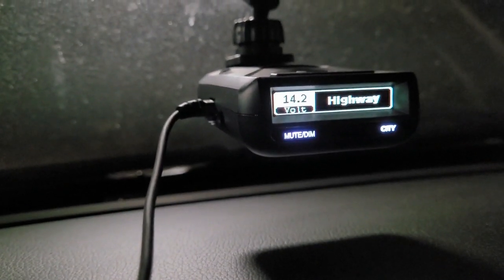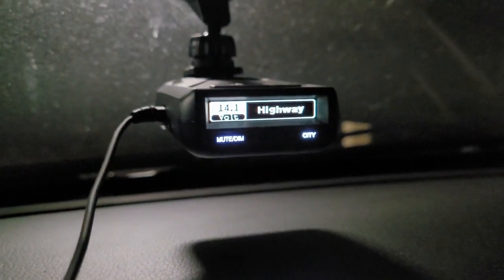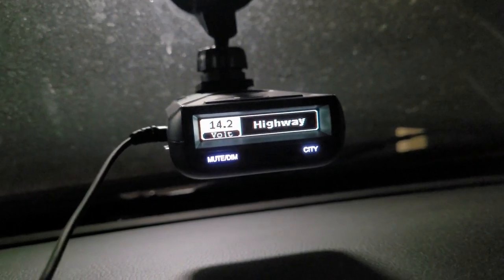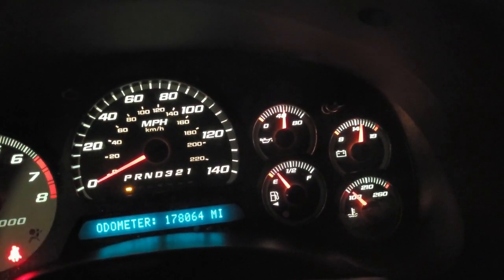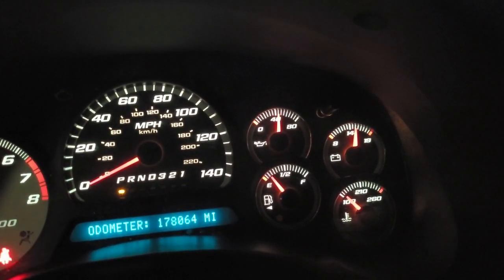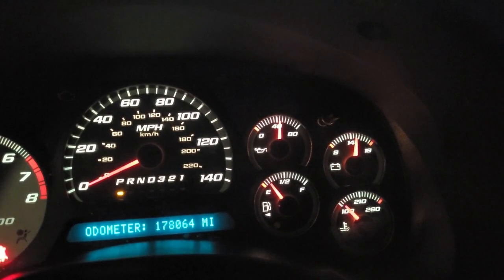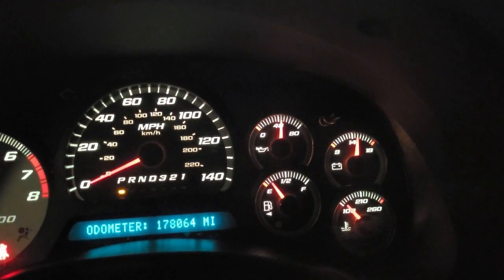She is not going up to 15.2 like before — she's staying around 14, where she should be. I hope this helps somebody. I was having the voltage going up to 15.2 and it would even drop down to about 12.9 during a run — it was all over the place. I thought it was the voltage regulator on the alternator, replaced the alternator, and it never fixed itself. Changed the battery to a brand new one and it still jumped up to 15.2. A friend told me the voltage regulator, even if it's in the alternator, is still controlled by the computer.